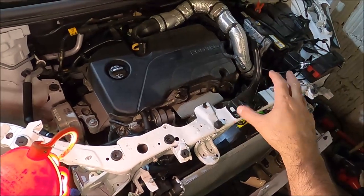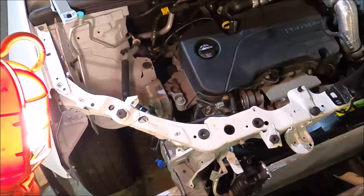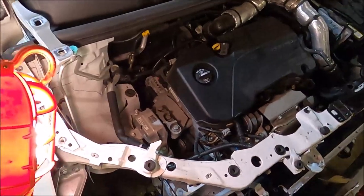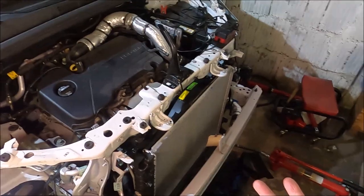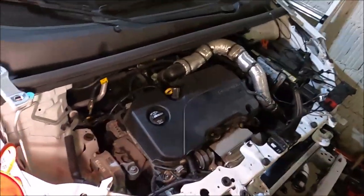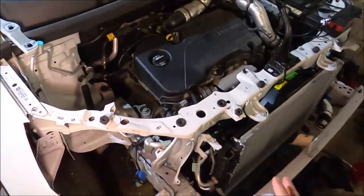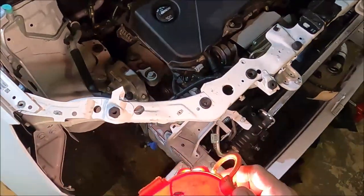I'm gonna hook up the coolant reservoir, fill it up, bleed it, and also put in the air filter and intercooler. And I wanna give it a start, start it up. I haven't started the car since we got it. And on top of that, when we did start it at the beginning, we didn't let it warm up. We didn't let it warm up because it didn't have any coolant. So now I want to actually do that. So yeah, that's what I'm gonna do right now.